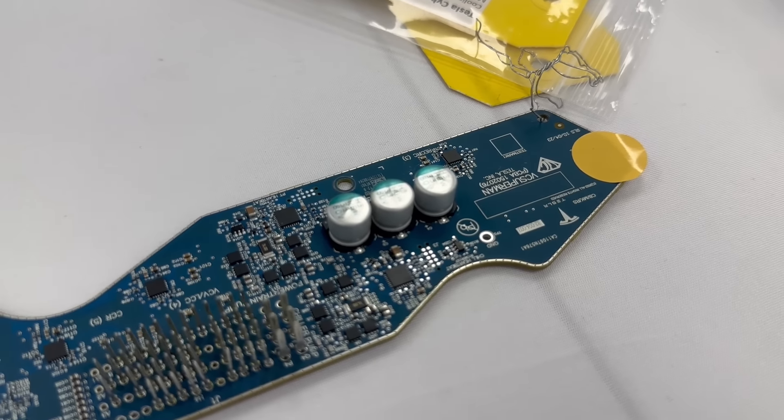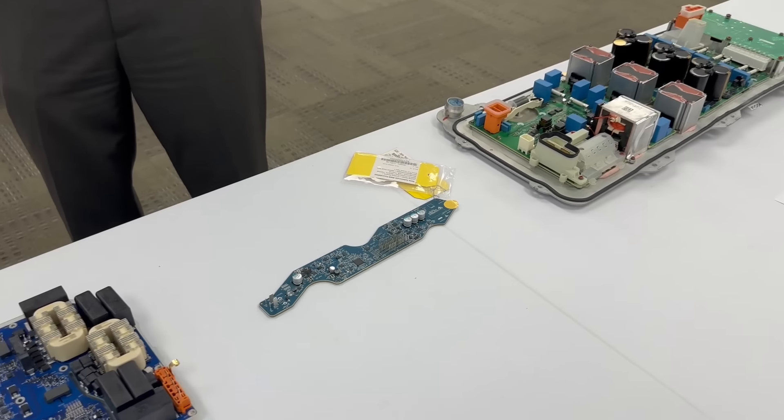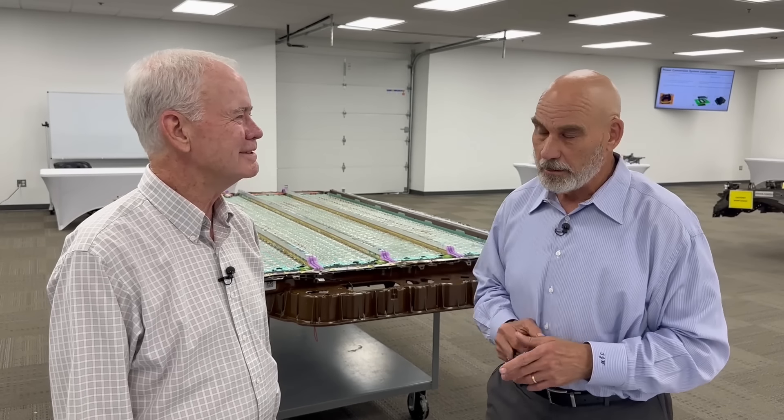Terry, thanks so much. This is great to get into even more detail on the Cybertruck than we saw before, and we got into a lot before. We're completing up the entire 48-volt architecture — we're feeding the 48 volt from that down to the whole system. So I think the last step here is to show how that's being allocated, because it's not all 48-volt. There are still 12-volt legacy systems in there, so you have to get transformers down from 48 to 12 yet again. We'll be able to show you how that's being done and what the benefit is of doing that and what it costs them to do. Really appreciate it.